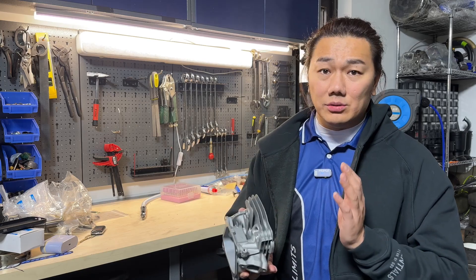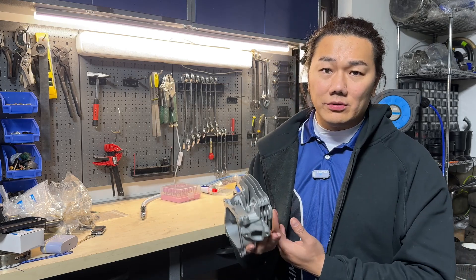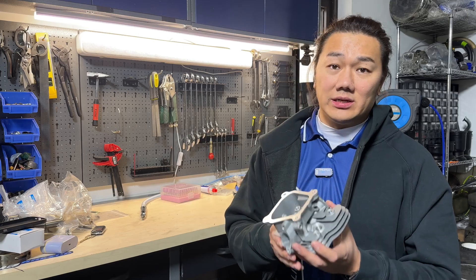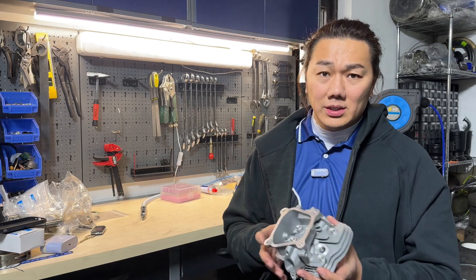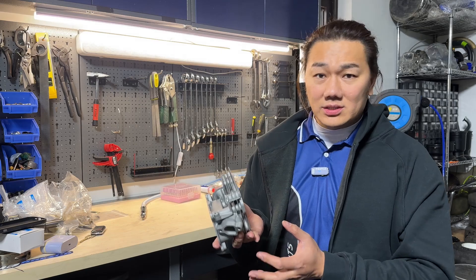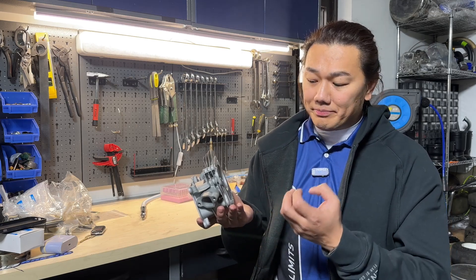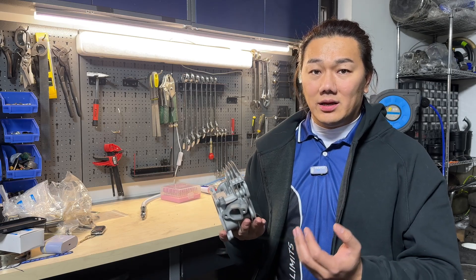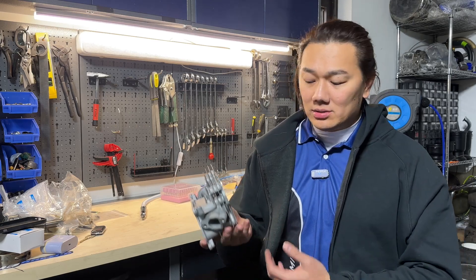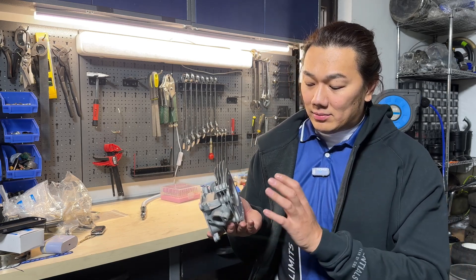These channels when they're cast — they don't care too much about making sure everything is nice and smooth. There are rough edges within these channels which can cause turbulence when air or exhaust travels through. Never take away more material than you need to, because it affects the velocity of the air traveling through. You're basically ruining the venturi effect by taking too much material out, since these channels are designed to a certain diameter to operate properly.